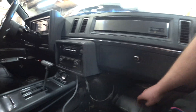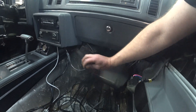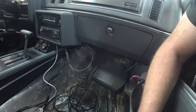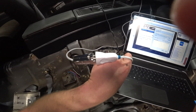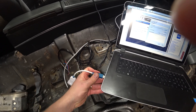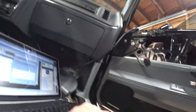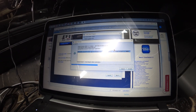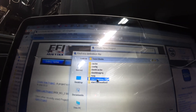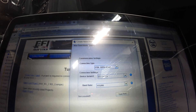Looking in the car — the new Megasquirt ECM is partially installed. It requires a vacuum hose, and right now I haven't run it through the firewall, so I'm going to run it out the window. I'm going to install the driver for this USB serial adapter. Let's see if it will detect the ECM — successful.